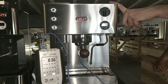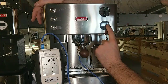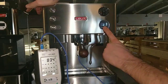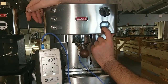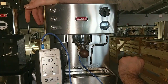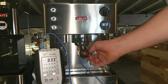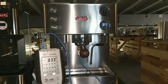Good morning. This is the PL9-82T with the factory setting. We have PR, pre-infusion on, pre-infusion off, Kp10, Ki0, Kd10, B30, EC10 — very important, this is the offset — EC10, ES0, F01, TR. We can set 1, real temperature, turn off, turn on. Factory setting: 89.5 degrees.